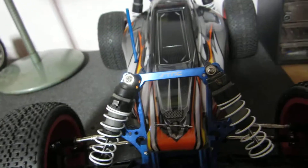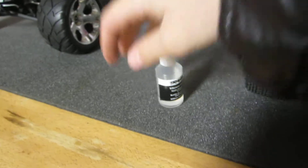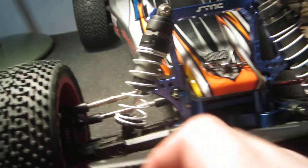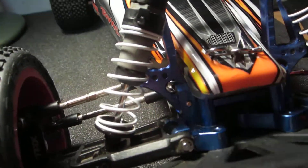One reason, or a couple of reasons why your car may be making that noise: one, you don't have shock oil. This is silicone shock oil. Your shocks in your car, right in that little canister behind the spring, have actual oil in it called silicone shock oil. Every time you push your shocks down, it's re-lubricating that. If you didn't have that, the metal would be sounding really terrible.